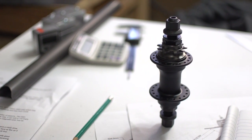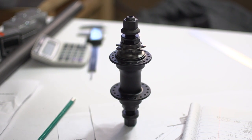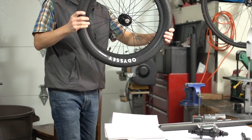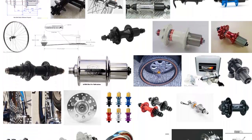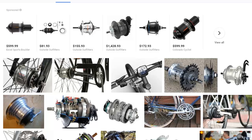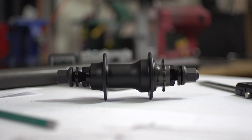Okay, so a change of plans. The first thing I'll show you guys is what I had for the rear hub — it's a 110 millimeter BMX axle, which may have been okay, but after reading a few comments, first by rock shandy and then from cycle trucks, I decided to go with a 135 millimeter axle. This was their recommendation and it's a really good idea for a number of reasons. The main reason being options — I could, for example, decide I want gears on this bike, and if I had gone with a 110 that's pretty much impossible, but with a more standard 135 I have the option to throw on an integrated gear hub.